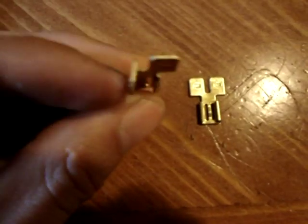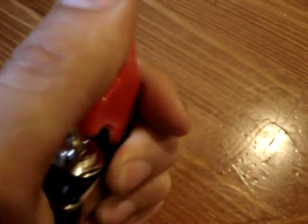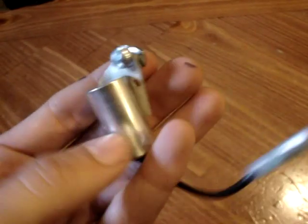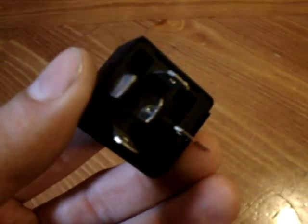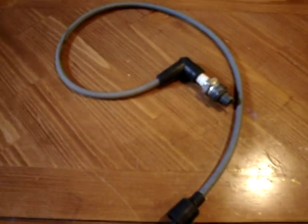Take one of the wire connectors and bend the tab at a 90 degree angle like this. You need a 12 volt switch — in this setup I'm using one with little screws that go into the tabs and a safety cover switch. Here is the 600 volt condenser from Nappa, and you need a little screw and nut going through the mounting bracket. You need a 5 pin relay — best if it has a mounting bracket. This is a 30 amp relay and the off position is always connected from 30 to 87A. Next is a spark plug wire with a spark plug of your choice — got this at O'Reilly's for three or four bucks. You need a hose clamp that fits around the coil.